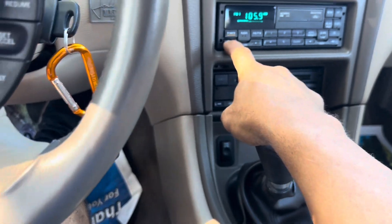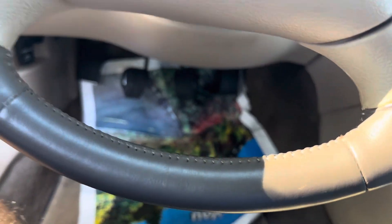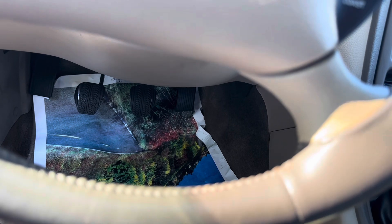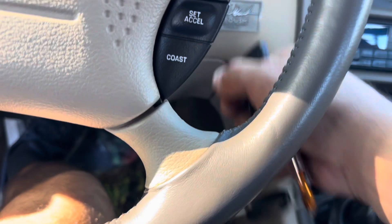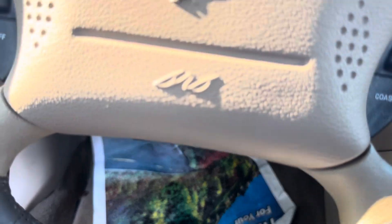In order to get the remote start working, we had to do the clutch bypass at the point of cranking, so it's done the proper way. That way, when it's not on remote start and you don't hit the remote start, you still have to push the clutch to start it as normal. When we do the remote start, the bypass only activates at the point of cranking — that way the car starts, and that's pretty much it.